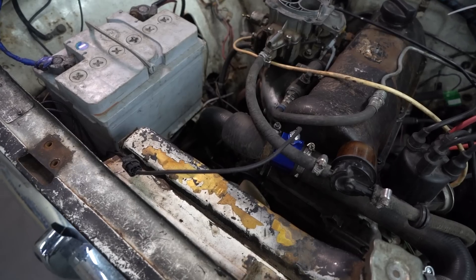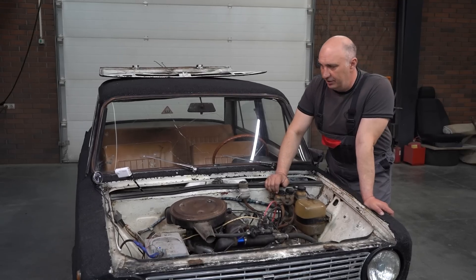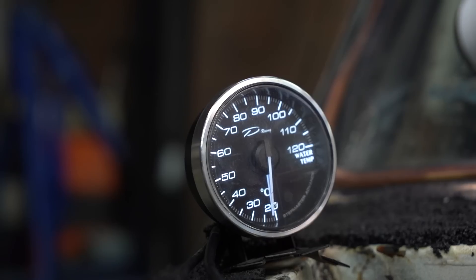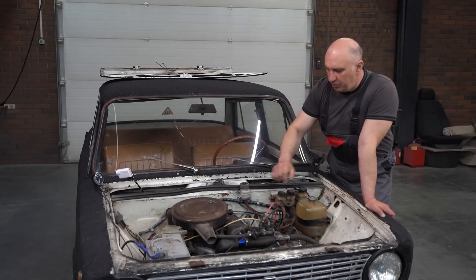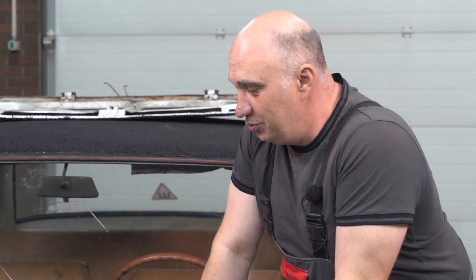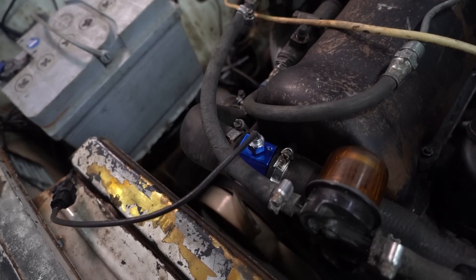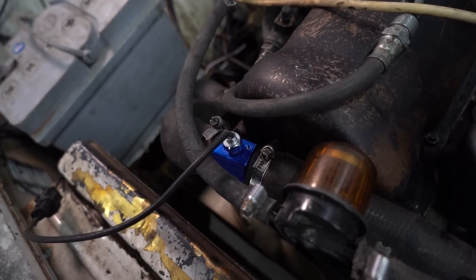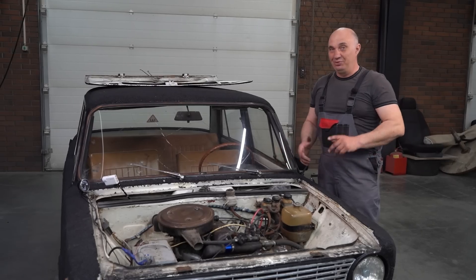We've done a little bit of prep. We've installed a temperature sensor that gives us a reading on that gauge. The sensor itself is right here inside this hose that'll be transporting the coolant. So let's imagine, here you are in a traffic jam, and all of a sudden you're overheating. The idea here is to simulate that scenario, see how quickly the temperature will rise. Let's fire it up just the way it is — with a four-blade fan, no shroud or anything else — and see how it behaves.